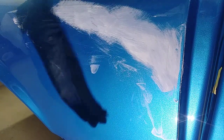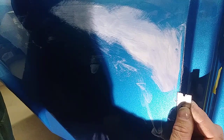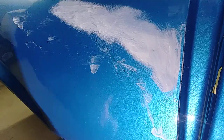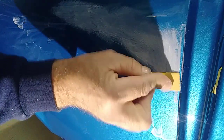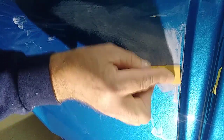This run here is like an icicle. I'm going to actually cut it with the razor blade. I'm going to remove the very end of that run. Now I'm going to focus on it with a smaller Bondo spreader. I have a big variety of sizes and shapes of these that you just cut to conform to what you know will work best to remove your run.